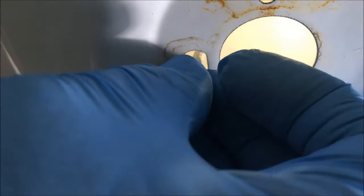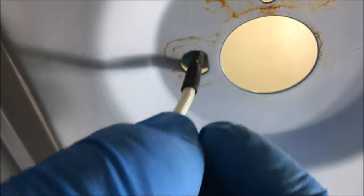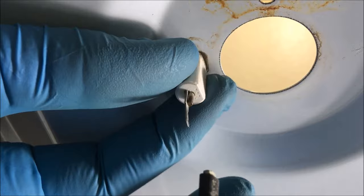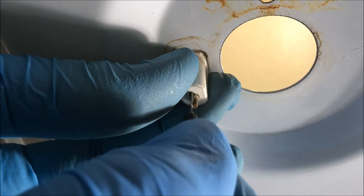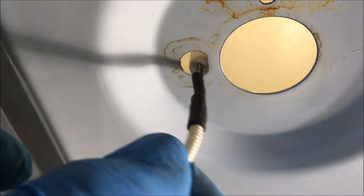So if you want to do it on top, you put this through, put the wire through, attach the wire to the new spark igniter up top, and bring it back down. But for purposes of showing you how to do this — which I'm sure you've caught on — just do it from the bottom. So grab the insulation right there, the insulator, and push that right on. Push the wire on, and there you have it. You see how that is?